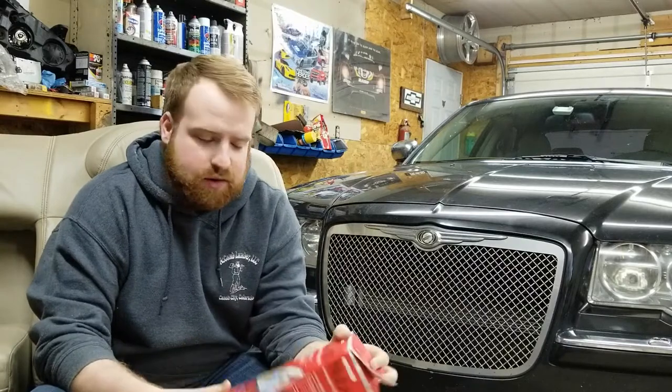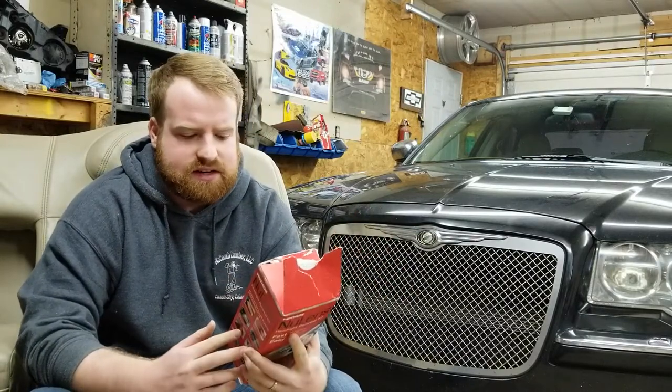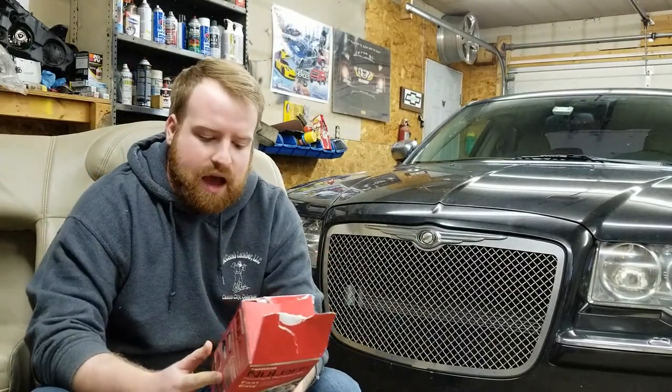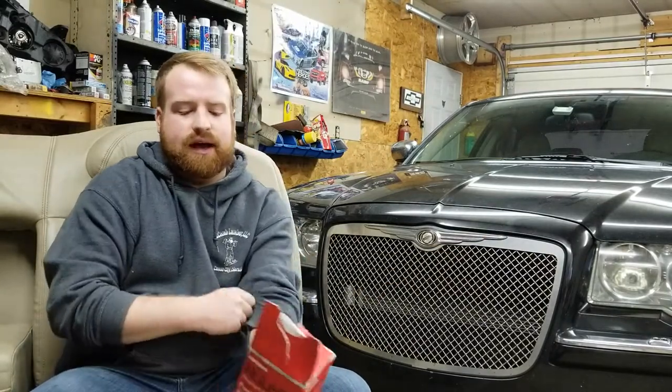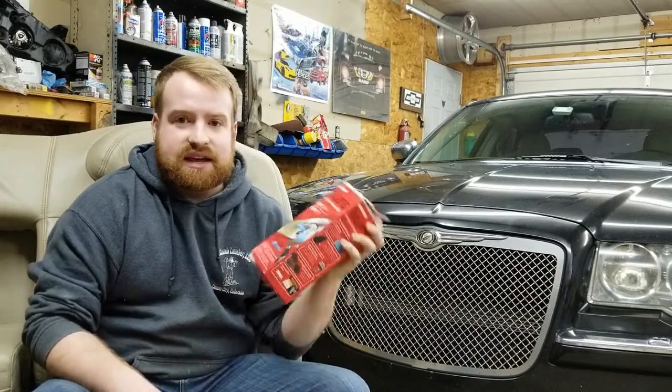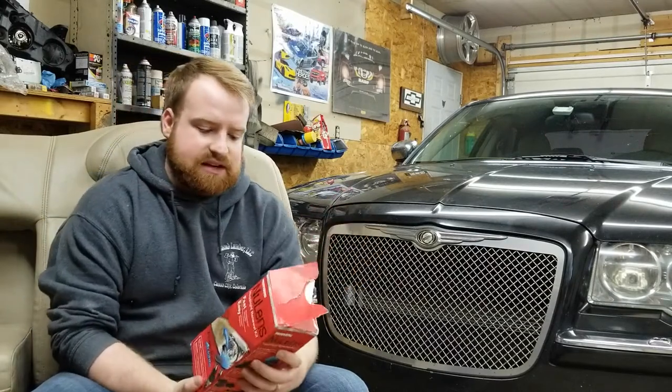Here are my final thoughts. I actually didn't even know what brand I got, but I got Mother's New Lens Headlight Renewal Kit — I think it was $19.96, I already threw the receipt out. I have bought the Turtle Wax Headlight Restoration Kit before; it comes with really tiny little sanding pads that you do by hand, and we wouldn't even be close to being finished with them — probably we would be done with one headlight. They never came out anywhere near as nice as this, which isn't even perfect. So I would definitely recommend spending the extra money. Get a set — even if it's not this one, I assume they're all probably pretty close — get a set that you can stick on your drill and use it that way, because it's a lot easier. Otherwise you're going to be really tired by the end of it.